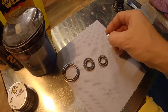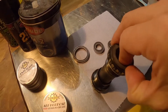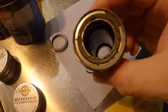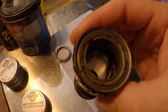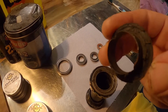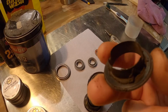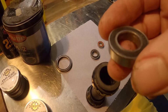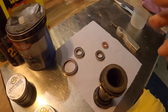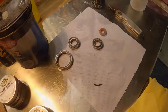That's a headset bearing. This one is a bearing out of my rear suspension assembly, and there are a few more of the same sort. There are also bearings in your bottom bracket. I've kept this one like this because I wanted to show you what can actually go wrong. You can see all the dirt and grime — even though there was some protection baffling there, dirt's got underneath and it will eventually work its way under this little plastic collar and into the bearings themselves.